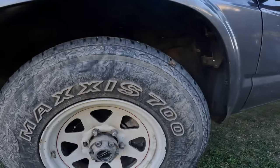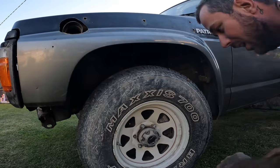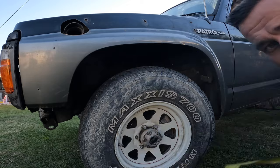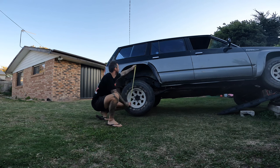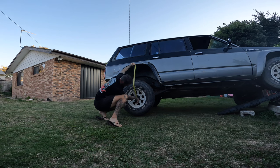Front flex is 705mm. Getting stock measurements at 470mm to center on the other end - just getting stock measurements so once we finish it all we can compare and see the differences. Now we've got the rear fully flexed up, just testing everything to compare when I'm done. Rear measures 810mm.